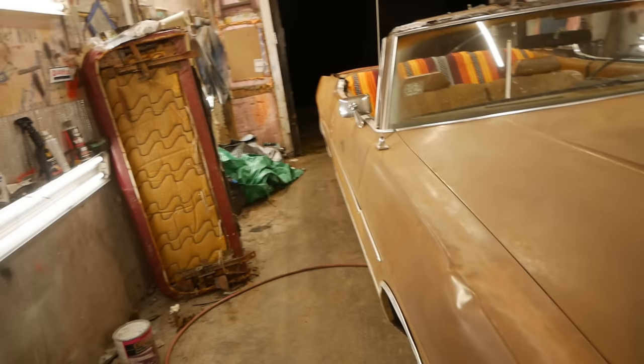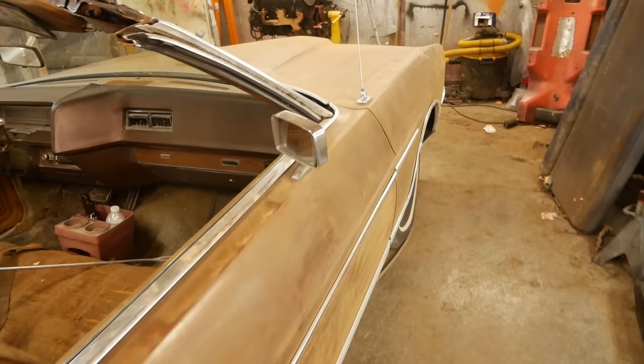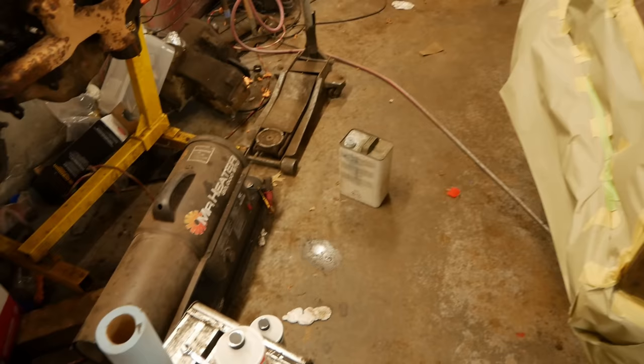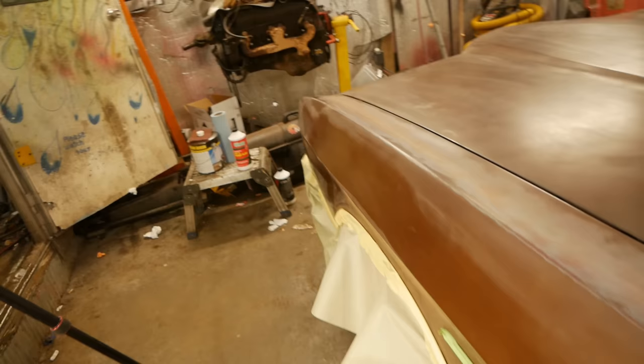I'm going to use a DA with a little sandpaper on it to remove the duct tape residue. Chase is proceeding nicely over here — nice and scuffed. The duct tape residue on this thing has been on here since approximately the Civil War. Now we're going to use a little wax and grease remover — that's going to remove any surface oils, handprints, and stuff like that off the surface. This is a good teaching moment: if you're going to half-ass something, you've got to know how to do it right. If you skip this step, you'll pay for it.